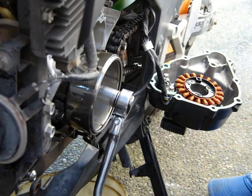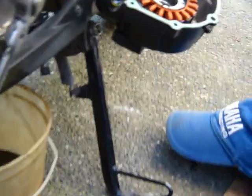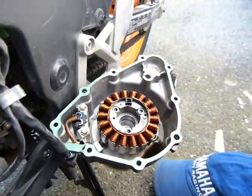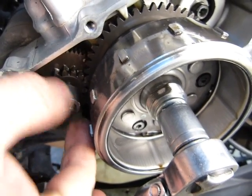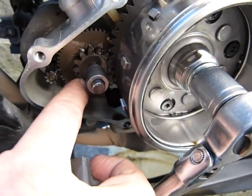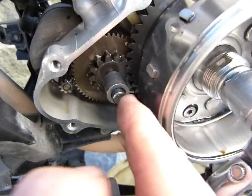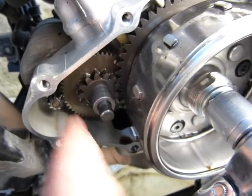If you do so, you're going to have some problems. One, it's got oil behind it, so I'm doing an unplanned oil change with it. When you pull out this half of the cover, you're going to pull this axle with it and that shim on it. And then this pair of sprockets will drop — that one belongs to the starter motor, which is sitting there behind it. This axle will come out and then that sprocket will drop.